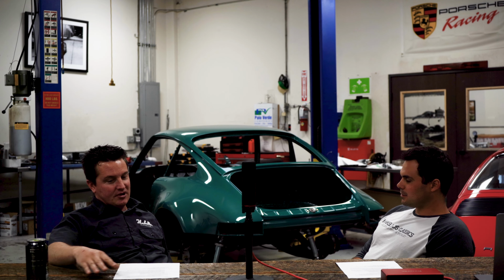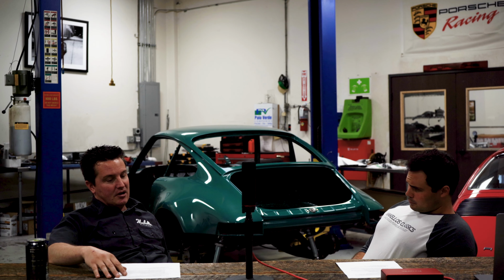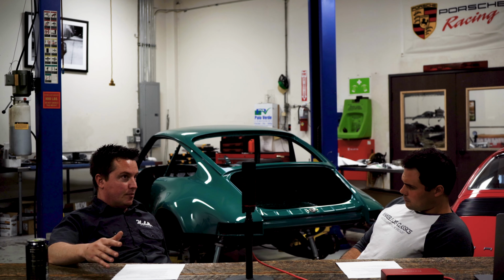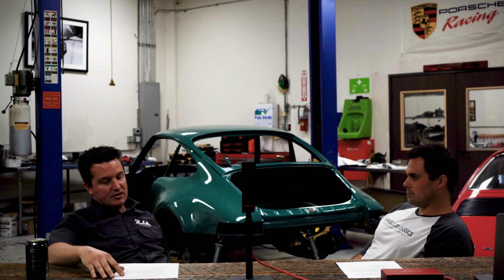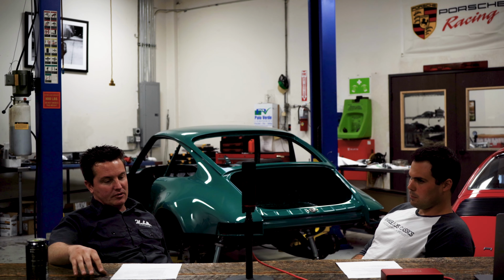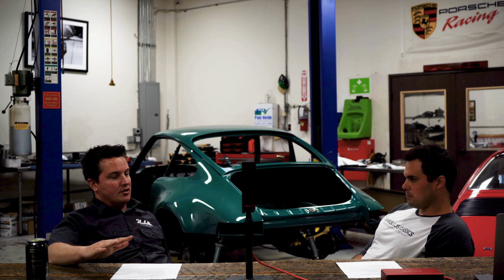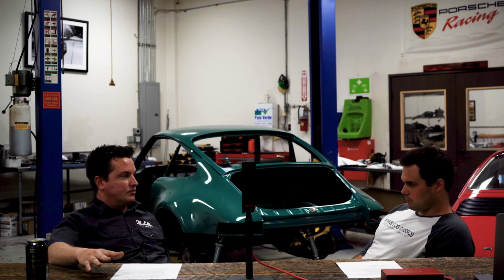As you do those coilover conversions, your rear spring plate changes. So we do the 935 spring plate, which we've put in the past three or four builds. We just decided to do the front in this one. We didn't want too many heim joints, versus the Oslo build that we did, with a lot of heim joints, 935 front and rear. This one we want to keep more of a canyon carver with light track use.